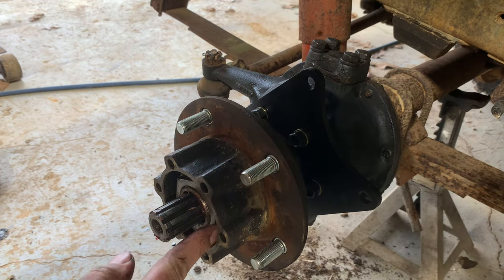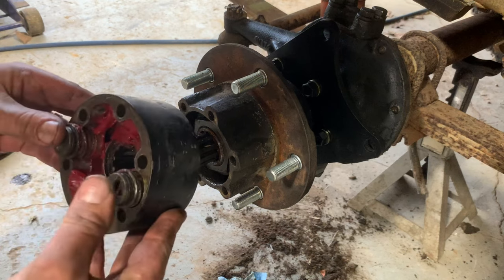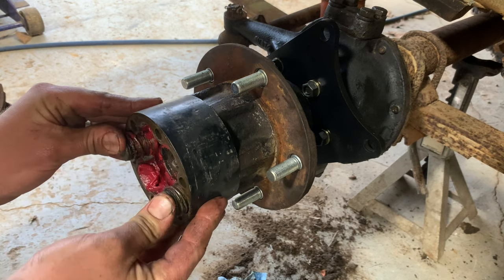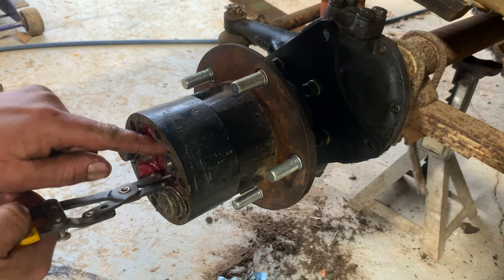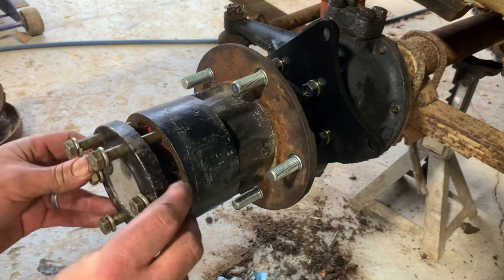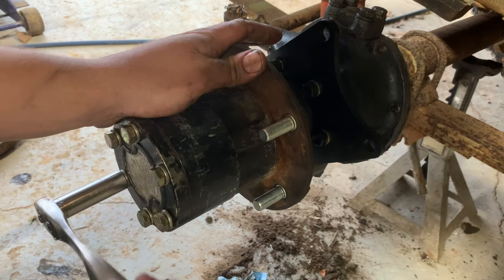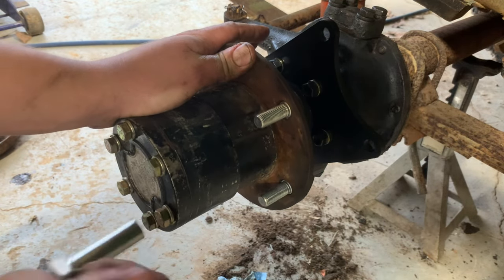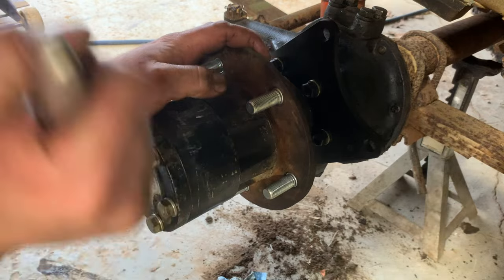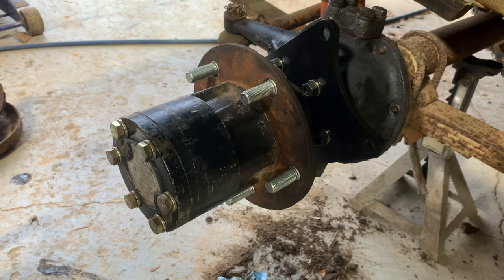And then the last thing to do, you bend that washer over one of these flats. Go ahead and put my lock and hub back on, and the cover. Always be careful tightening up your lock and hubs, because too much and you can actually crack them, because a lot of them are just cast aluminum. So that's got this assembly all back together.